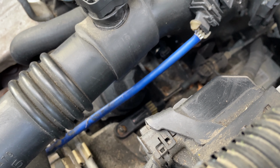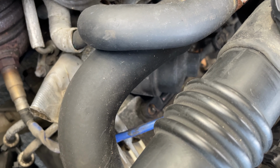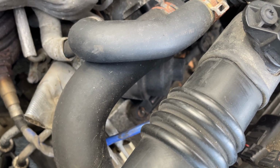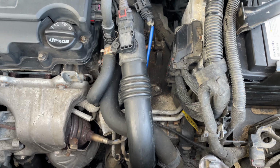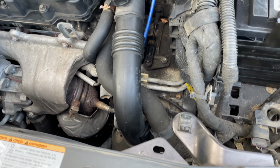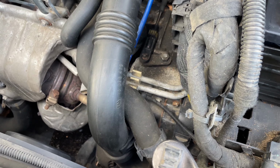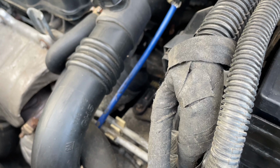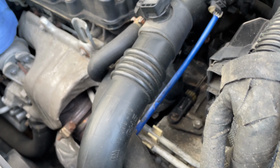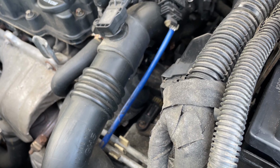All right, now depending on your vehicle, you'll need to locate where your oil filter is. Mine on my Chevy Cruze is right here in the engine bay, really convenient to get to compared to having to get underneath the vehicle. Not a whole lot of room in there, but it's important to have the correct tool to remove your oil filter. You can either get an oil filter wrench, which I will link down in the description, or in my case, I'm just going to use a wrench for this oil filter cover.